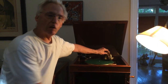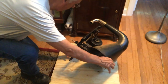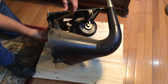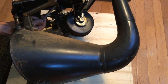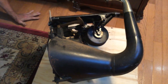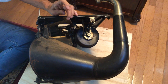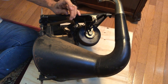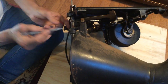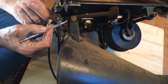You have to climb your hands in here with a flashlight and try to do all this by yourself, or have someone help hold the flashlight. This is the tracking main gear, and this right here is the other gear — this runs into this gear. They're both gears. Tracking. When you lower it down, it should just barely touch — it'll float like that, come down with a little bit of tension. If this pin with a spring — the spring tensioning — is too stiff, you're going to have to undo this screw and play with it back and forth. Sometimes you have to take it out; you might have to take the whole motor out to get all this done.